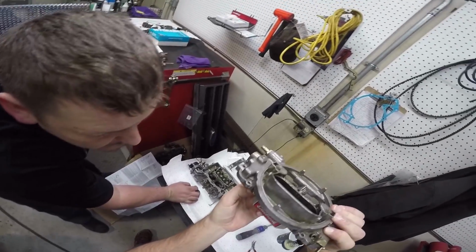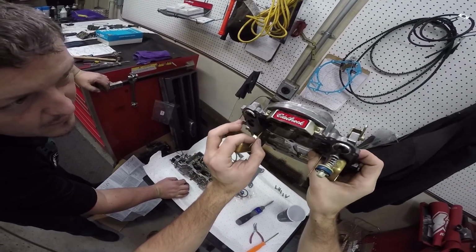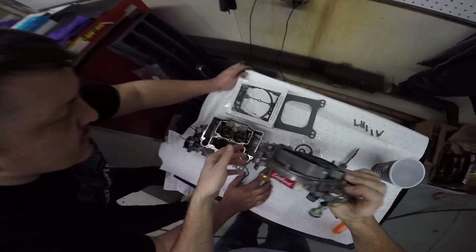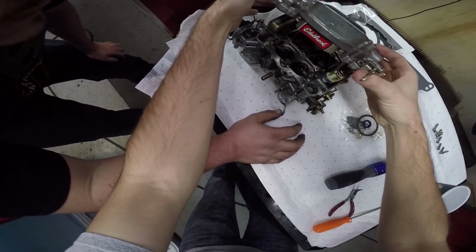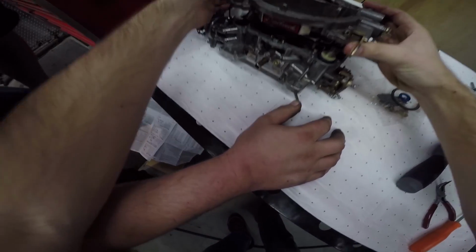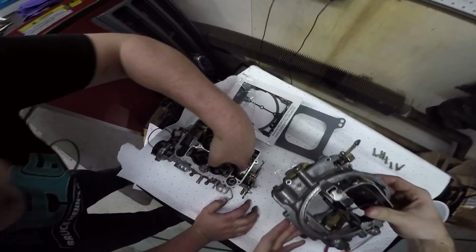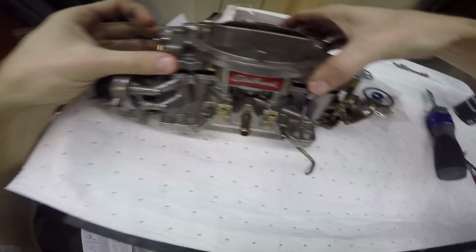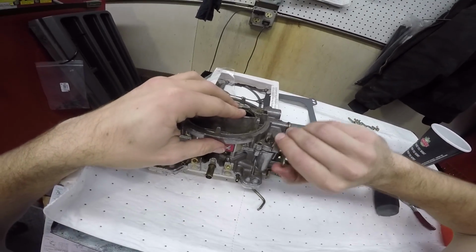Yeah. I'm guessing they act like a motorcycle's needle jet would. They're tapered down at the end here. Or they have 2 steps. Where does it sit in? These things sit in here? Yeah. Somewhere. I don't know. Let me look at it once again. Unless I have this backwards. Yeah, you're right. They sit down in here. So yeah, that's how that'll work. So the float comes up and seals it. That's how it fills the bowl.